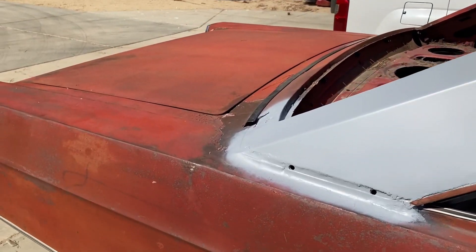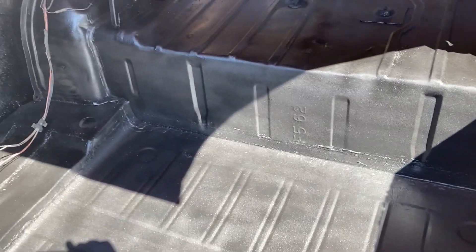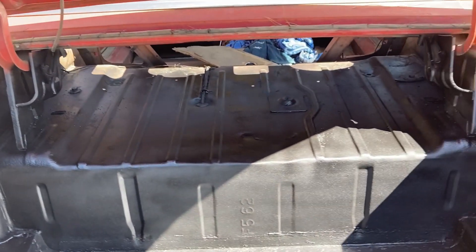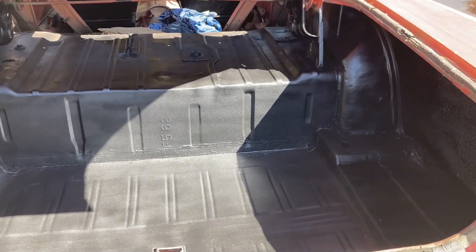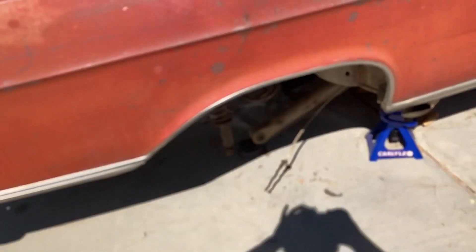I finished putting the primer on - couple coats on, masking removed. That's just enough to cover up the bare metal and keep it from rusting further. Here's what the trunk looks like after finishing the undercoating - good enough. On the interior cabin area we're actually going to do something called Lizard Skin, which is kind of like a spray-on bed liner and a higher-quality product than this rattle-can rubberized undercoat. It'll be gray in the interior, and I'm going to mask off a line where everything forward is gray and everything behind is the black undercoating. That's it for this video - next video I'm hoping we'll be putting the rear end back in and fitting the new suspension. Catch y'all later.